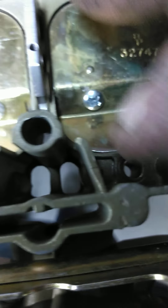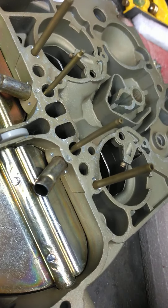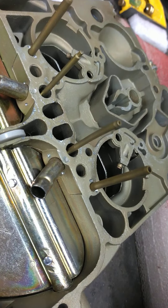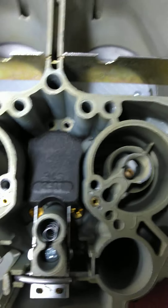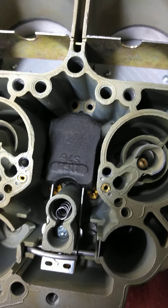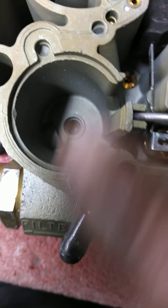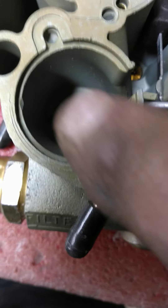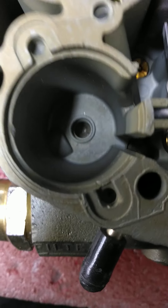So I've got one plugged on this side and this one's bent. I'd have been screwed right out the gate, having issues on this. There's a $400 carburetor and it's just a piece of junk inside. There's also a lot of trash down in the corners — the whole thing needs to be blown out. And I noticed this piece is missing. See this little ring right here? That's the lip of a little phenolic spacer that drops in there, and it's missing.